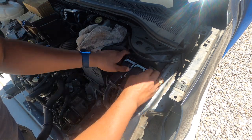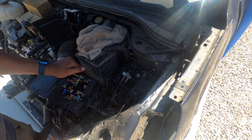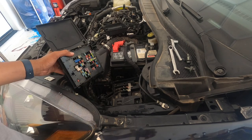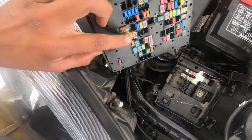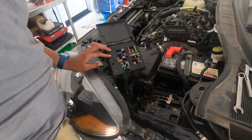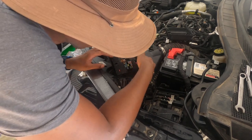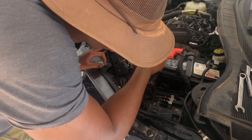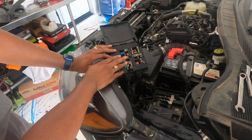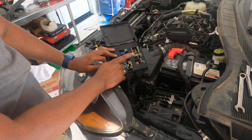To remove the fuse box, all you've got to do is lift that clip and pull these two down. Boom — all the fuses that we need. I put that fuse in for the fan. Hopefully that's the one, but that's the only blown fuse I've seen so far. I still might look around some more because I also have a brake light issue for the electrical brake, and I don't even know which way the counts go on this, so I'm gonna check on that and see which fuse is for the brake.